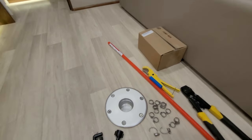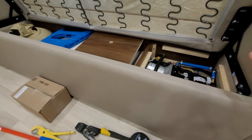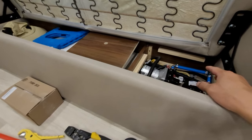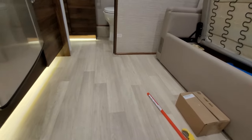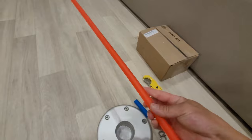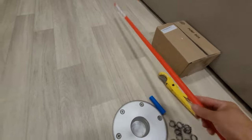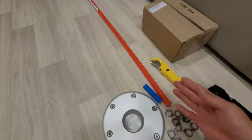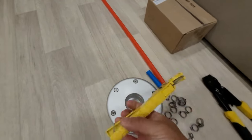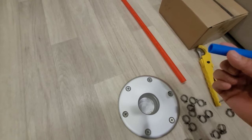The other thing I carry is plumbing components, because any time you have a water outage, it can ruin your entire trip and make your RV almost unusable — obviously the toilet, the sink, the shower. Besides the water pump, I carry an extra small stick of PEX tubing, since most of the plumbing inside the RV is PEX tubing. I also specifically carry a small PEX cutter, as it helps you cut straight edges better than trying to use a utility knife.